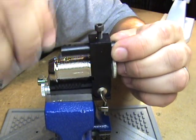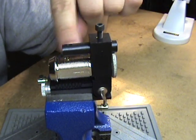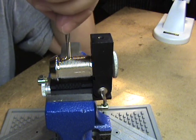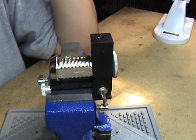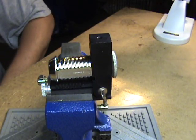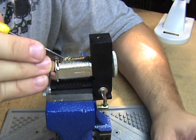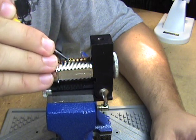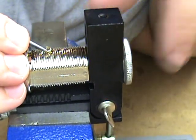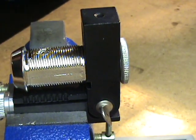You tighten the set screw down and then drill straight down into that plug. A lot of the newer plugs are already threaded, so once you've got that plug drilled completely through, you can remove this and use a tap to pop the plug out. I've already got that one drilled. Another method — if you don't have this kit — is to drill a small hole just in front of the plug and then just use an ice pick and pry this little brass plug straight up out of here. As you can see, that plug comes right out and that's what it looks like.